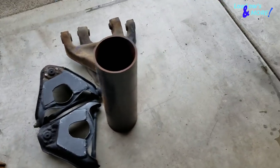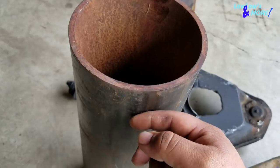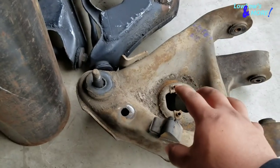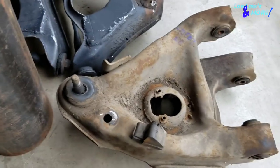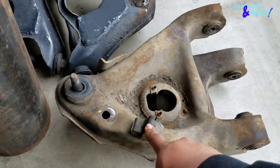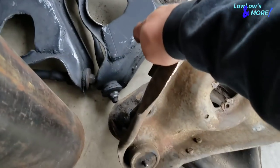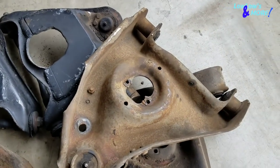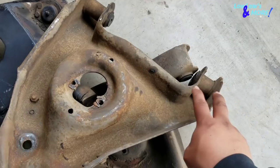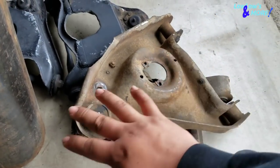For building lower A-arms, I got this solid piece of pipe right here. We're gonna cut a big hole and put some of this pipe in there so we can get close to fitting a whole stack of a coil spring in the car. This one belongs to that green Regal I worked on before. As we cut them, we'll put a big piece of pipe in here, reinforce the bottom, and the reinforcement is gonna come up to here.